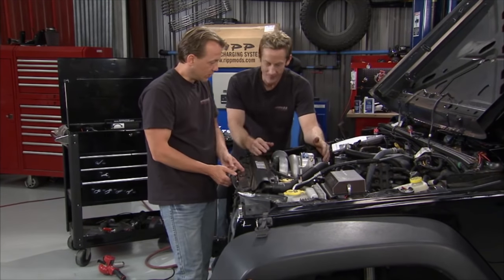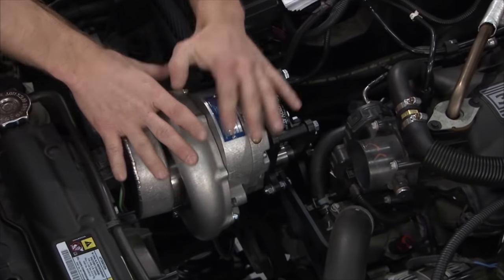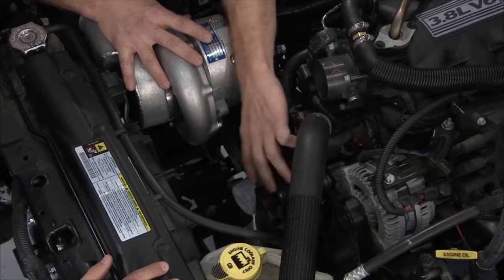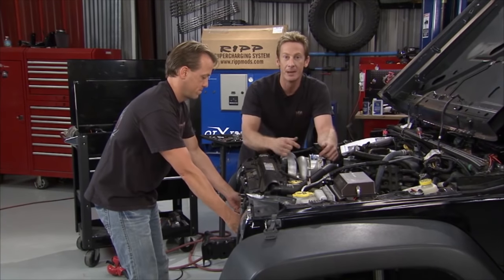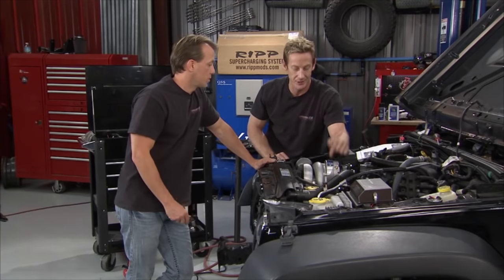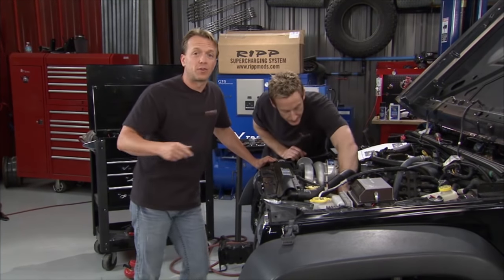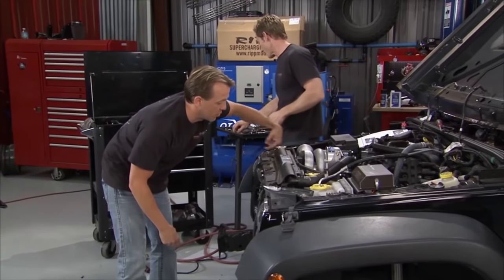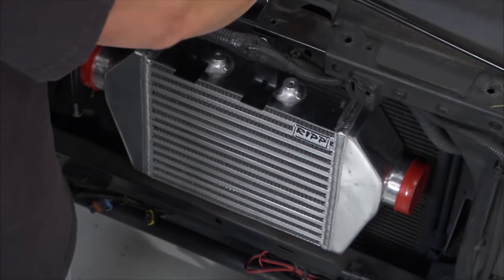That supercharger looks awesome — it just looks powerful. If you look at the front and see the compressor housing, you might think it's a turbocharger, but it's not. It looks the same and has the same function, just goes about it differently. With a centrifugal supercharger like this, it's driven off a belt tied to the crankshaft — that's the advantage over a turbocharger: instant throttle response. You hit the throttle, it spins up, and you've got boost immediately. A turbocharger is free-spinning and doesn't rob power, but you've got lag. With this supercharger, no lag — instantly close to 100 horsepower. The idea is to cram as much cold air in as possible through this intercooler, cooling it off before it goes back into the intake.